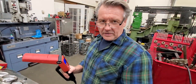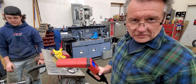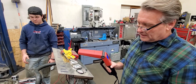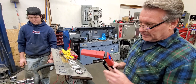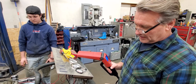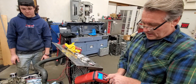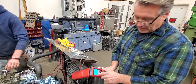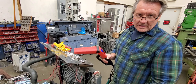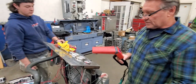I think this engine we have set at 33 degrees. But before we do that, I'm going to show you why you cannot do the old school way of 8 or 10 degrees at idle. We're going to fire this thing, let it warm up a bit because the choke's probably on right now and it's going to idle a little too fast at first. Once it comes down to idle, we'll check the timing with the adjustable light and see where the initial is before we take it up to 3,000 RPM. All right, let's fire this thing up.